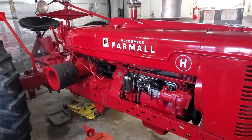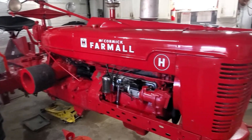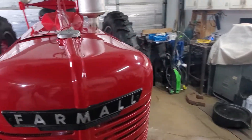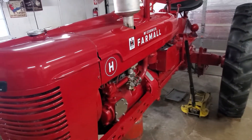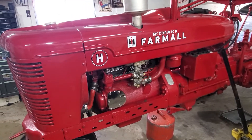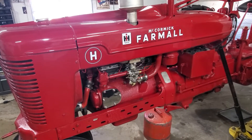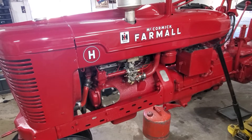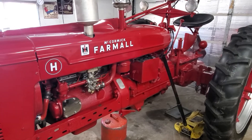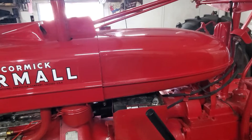When the tank is dry, you put in the actual sealer. The sealer is kind of like oil — thick, kind of like paint, actually reminded me of pancake syrup, like 30-weight oil. You put that into the tank, we put a piece of plastic over the opening, and then you just tip and twirl and move the tank back and forth, up and down, sideways — because the stuff moves around inside and coats everything. But it doesn't move very fast because it's thick like oil.